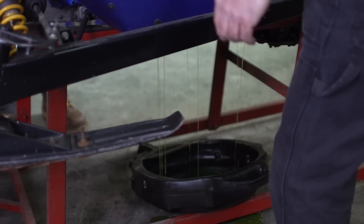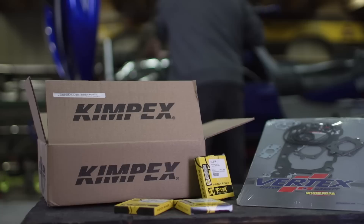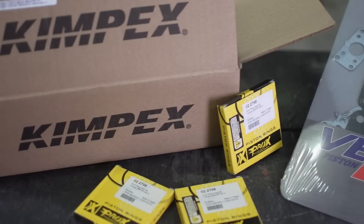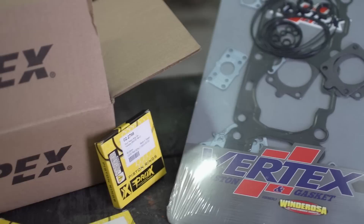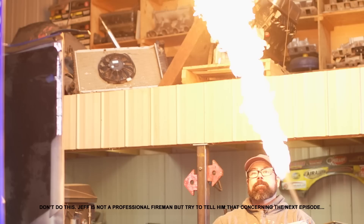Getting into a job like this isn't always a predictable procedure, but there's some things you'll need to do before you dig in, like order your parts. The most obvious thing to get is a replacement set of rings that are the correct bore size. I'm assuming there's stock on this SRX, but on any older sled like this one, there's always the chance that a previous owner did some cylinder repair work and went with an overbore that would require a larger replacement ring set. Then you'll also need new gaskets. I chose to go with a full set sourced at Kimpex — this kit even comes with new power valve gaskets, which will allow Brody to clean those things up while we're at it.